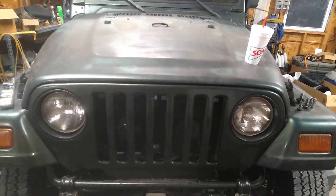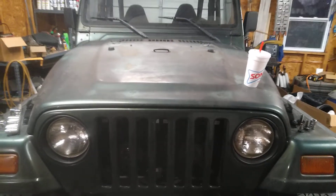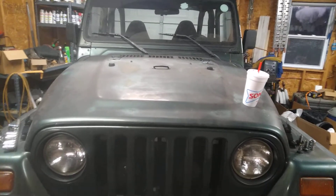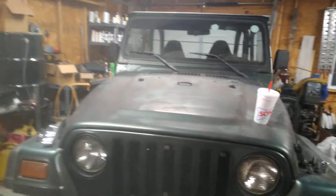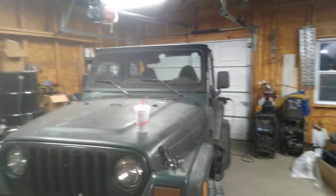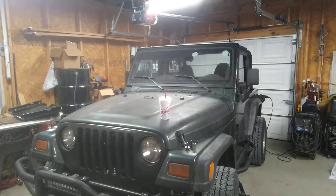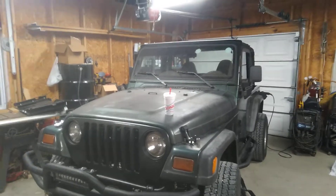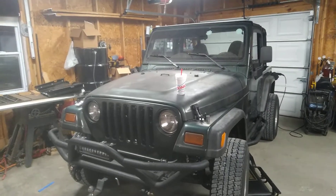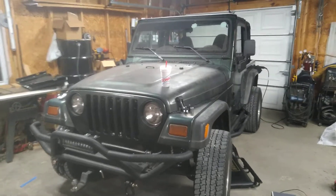Worst case, I may have to put a bigger capacity radiator up here. I do have some room between the radiator and the battery box, but not a lot. Removing everything and fabricating new mounts without taking the battery box out again is probably not going to happen, so if that's where I need to go, I'll just have to pull the battery box out again. As I sort of proved recently, it's not really all that hard to do — I just didn't want to, because it's really heavy and it freaks me out since it's a lot of money. If something were to let go and it came crashing to the ground, it might hurt something, including me and my garage.